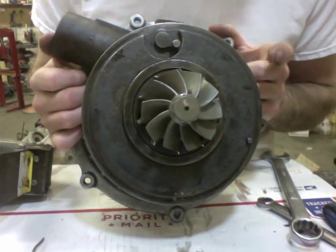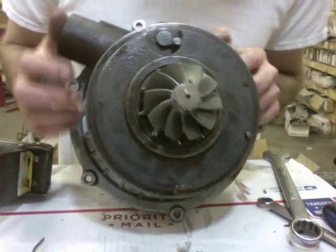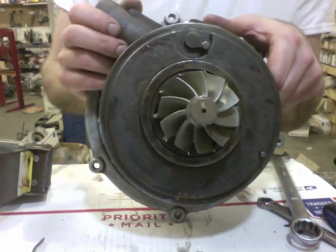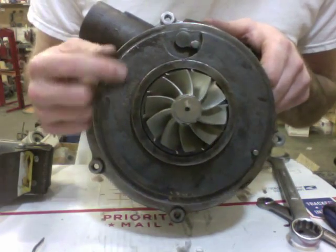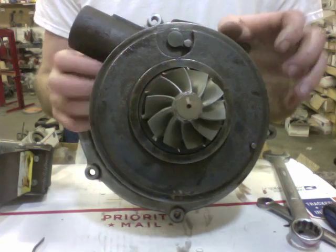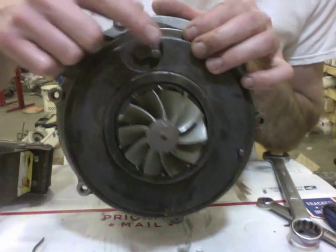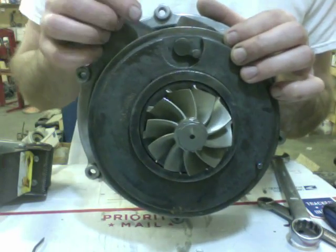Please leave any comments or questions about this rebuild. Don't forget to clean up the VGT system really well — that's one of the main reasons these turbos have problems. High sulfur diesel oil and diesel fuel will clog up the VGT system. If you have access to a sandblaster, don't blast the bearing housing, but blast the exhaust housing and all the VGT components well. Make sure the arm isn't worn either, because if it is you'll probably need to replace the whole bearing housing.